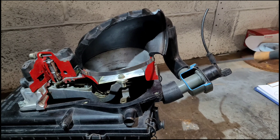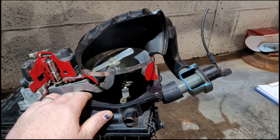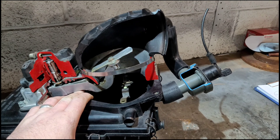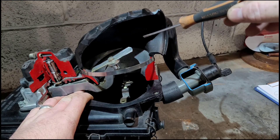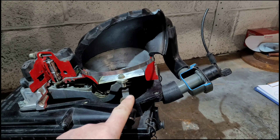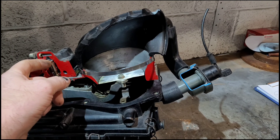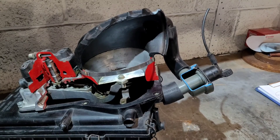When the throttle body is closed and the RPM is below 1300 RPM, this valve is not active and fuel flow resumes. When the valve is active, it pushes the plate back down to cut off fuel. Our fuel pin is already in position — this activates and diverts air through the trunking, pushing down on the plate.